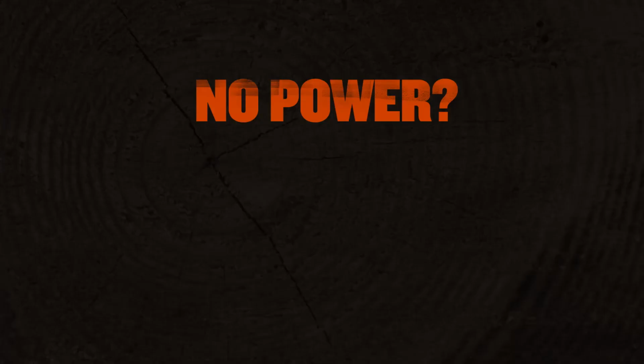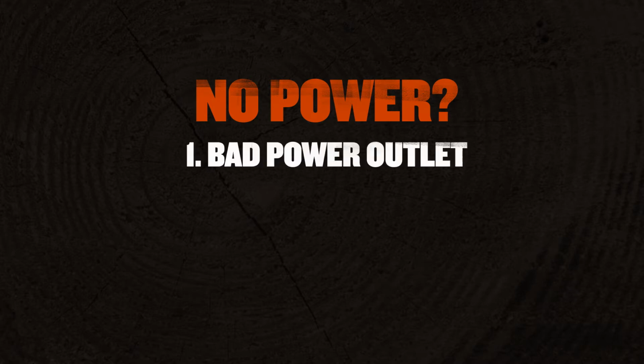I'm going to talk to you about a few really easy troubleshooting steps to see why your grill isn't powering on. There's only a few things that can cause this. The first one is that your grill is actually plugged into a bad outlet or an extension cord. So you want to maybe test it with a household appliance like a blow dryer or a blender to see if that power outlet is giving power.